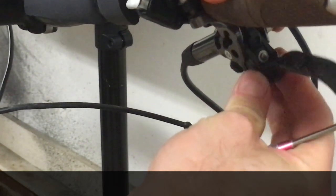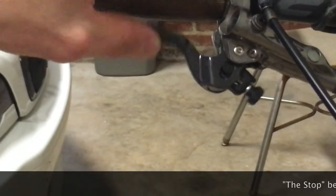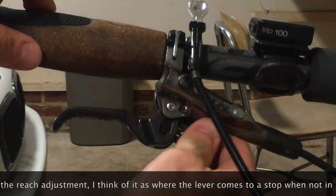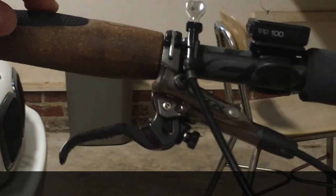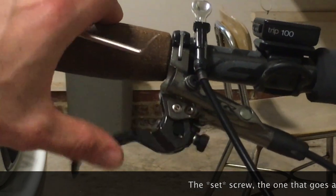I think it's moved a bit. You can see my finger here pushing on the pin. There it goes. So here we go — it's coming back to the normal location. Of course, I'll have to adjust the stop. I think the Shimano replacement was shipped with the adjustment completely backed out, so I'll screw it back in. As you can see, that changes the park position of the lever each time I spin this. So we'll adjust it out — it seems almost correct. Let's go a little bit more. Feels good — comes back.